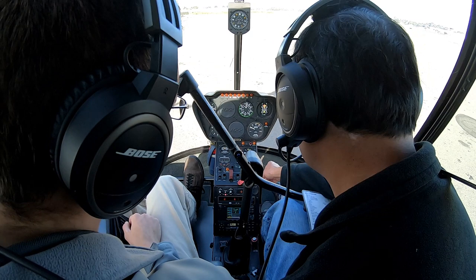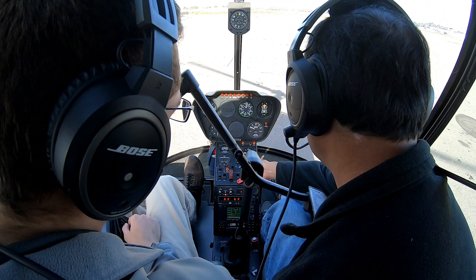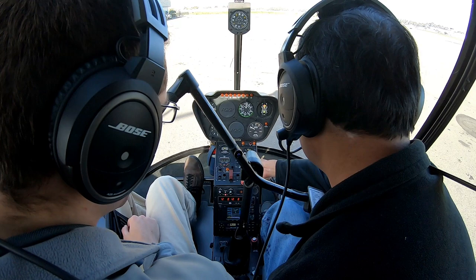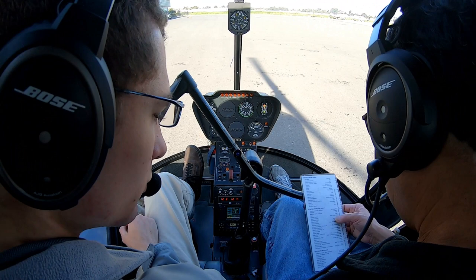Okay, so left mag. 1-1000. Alright, that one looks good. Good. Right. 1-1000, 2-1000. Good. Go back to both. Also looks good. Alright. Quick carb heat.